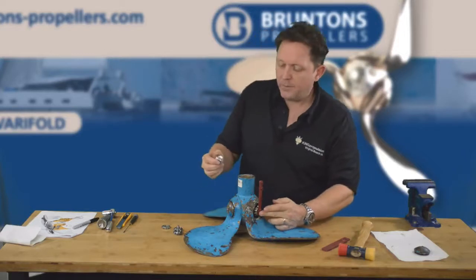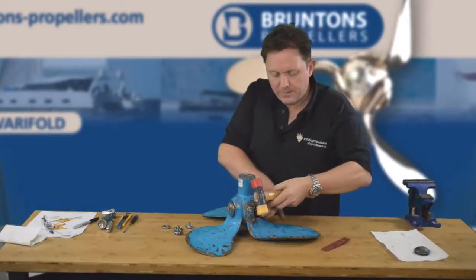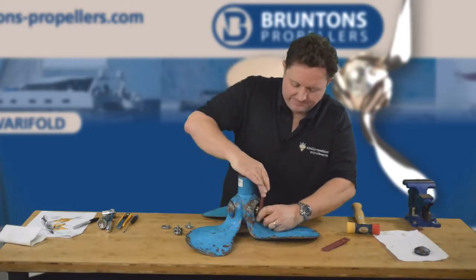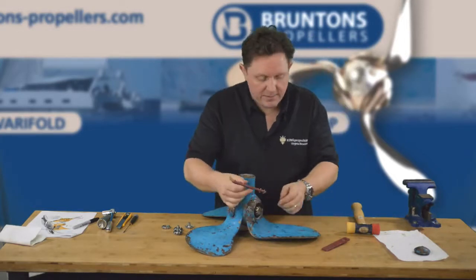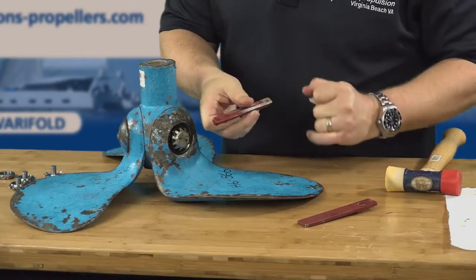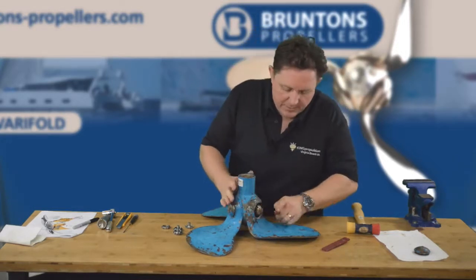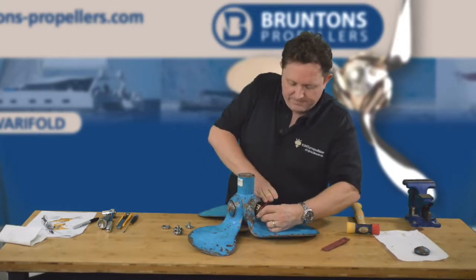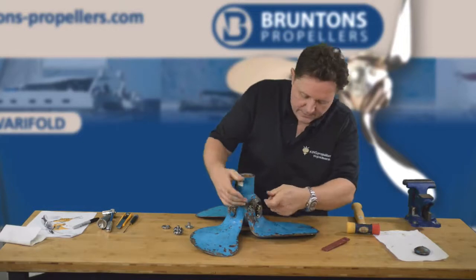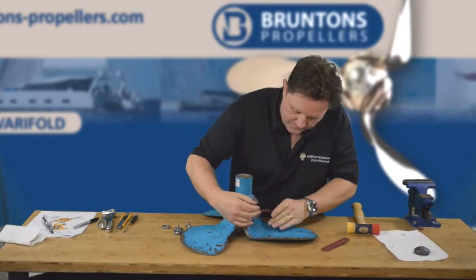When you put it back together you do put Loctite on, so sometimes it does need a little bit of heat to pull it off, and sometimes it does not. This is the little peg spanner that you get off the website. I actually had to modify this — the pegs were actually too large, so what I've done is filed them down. It was just a ten-minute job with a hand file. As you can see it's biting lovely and there's not much force required — it's really just the Loctite that's keeping it all together.